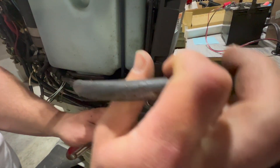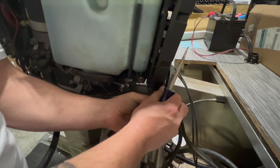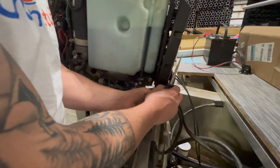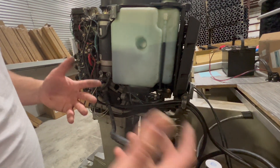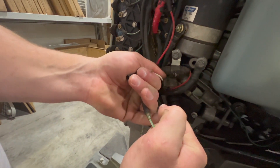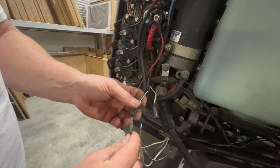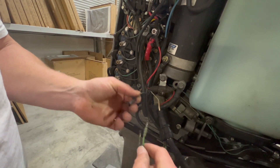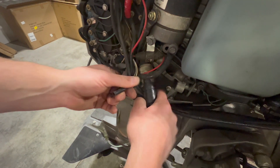I've gotten to where I can free up my main electrical harness. This is a different type of bolt than is in the bottom — we have a Phillips head in the bottom and a flat head in the top. I'm going to put this back so I don't lose anything. The best thing you can do is take some pictures of how everything is laid out and routed so that you can repeat that when putting things back together. Our next step is unhooking the plugs. You could label these plugs — I just take a piece of blue tape and put an A on it for the wire that was connected there. Take a nice clear picture, something you can repeat.